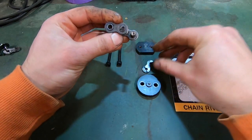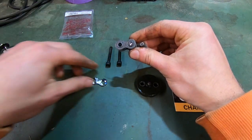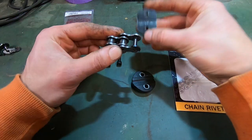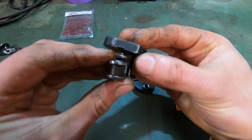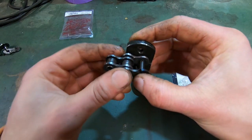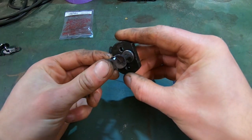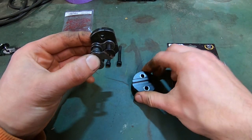When you're on the bike you've put your chain link over — mine's been cut off — but you put your other O-ring on, put your grease on, and then put this cover plate on. That side of the plate can be a bit tight to get on. What you then do when you use this tool is always put this plate in from this side — it slots in. One thing I noticed was a bit fiddly: the groove's not that big, and when you're trying to slide it in it has a tendency to move out either side. Be really careful that the plate is tucked in nicely on the heads.